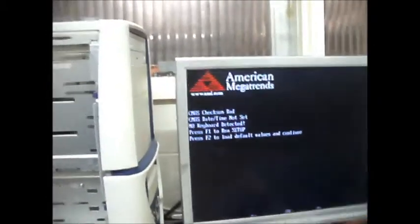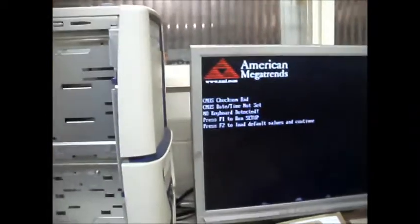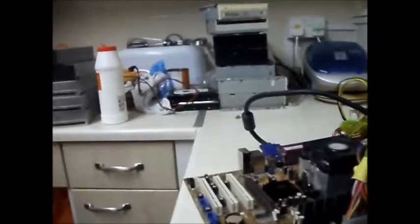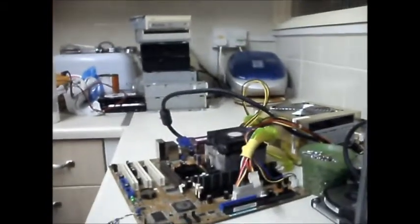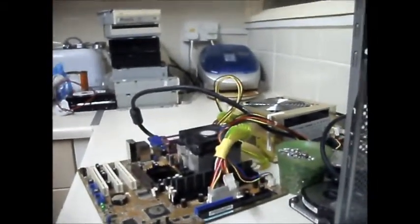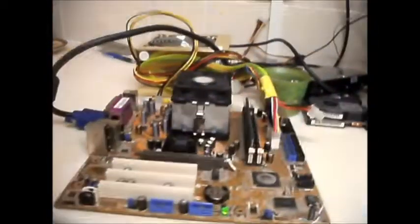Works. So I wonder if they threw this out, I don't know. Perhaps I just upgraded. So, 50-50 gamble with a scrap piece in. It worked out. Yeah, CMOS date time not set, and CMOS checksum bad, so yeah, I've got to do all that when using the motherboard.